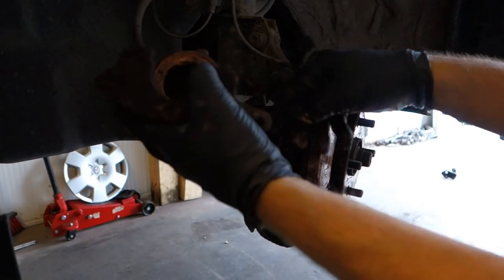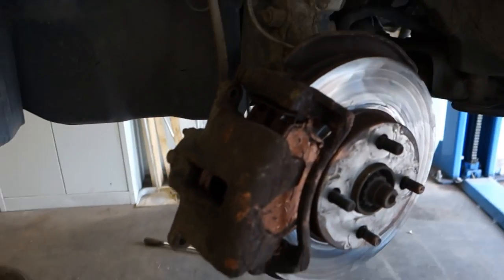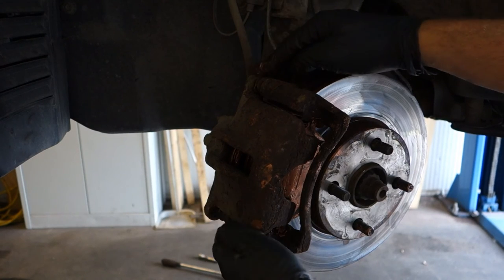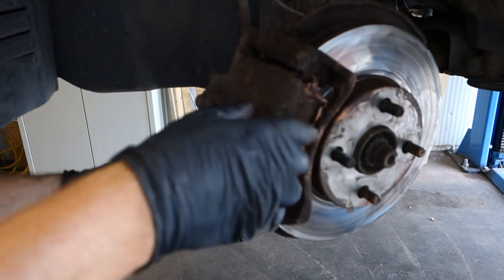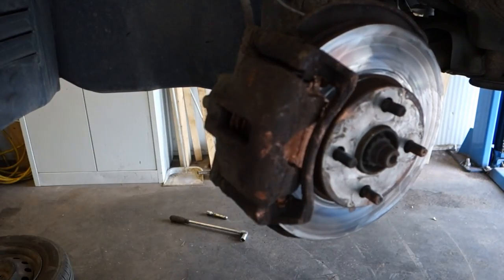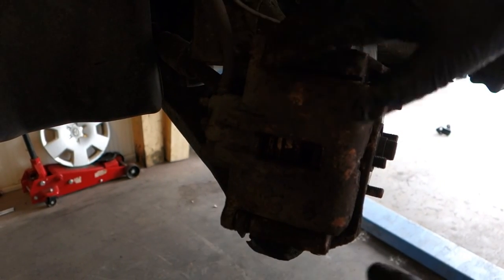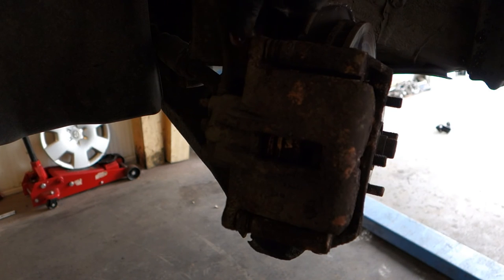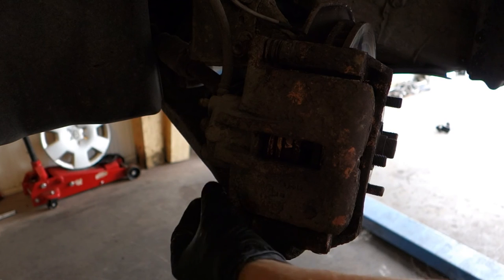And then I insert that caliper. This goes only one way, and then check that these bolts in here, they are in right position, because they must be just in the sides, and they take actually a little bit contact in here. And if it is difficult to install, please check that these things are in nicely. Now they are, and look in that area, because now these things in here, they are in nicely. When they are in that kind of position, we can take this bolt and insert this bolt in here and they run nicely in there. And then this second one also, and it goes also nicely.